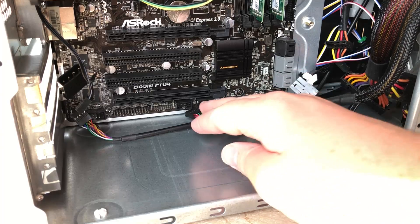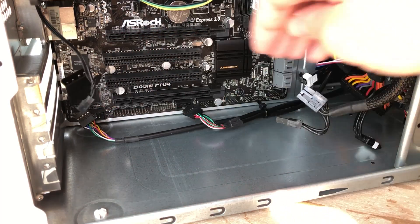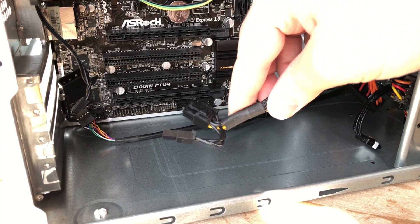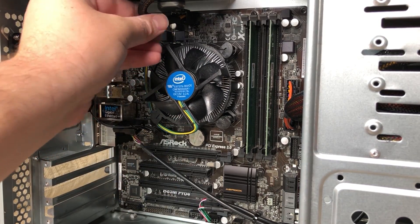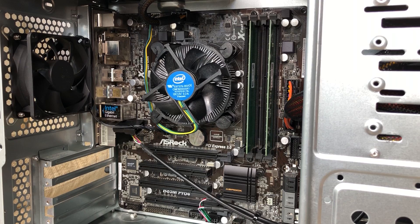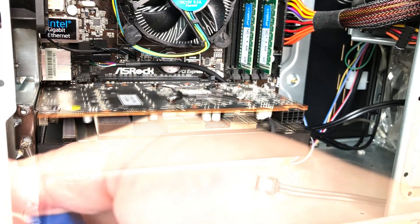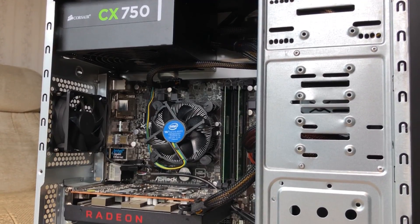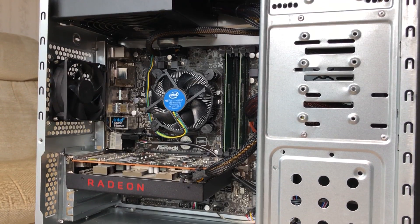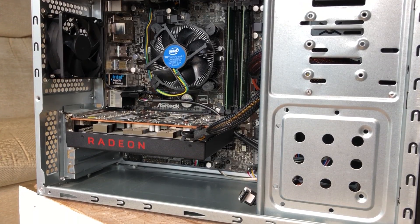Most of this motherboard's connectors are in a similar position to the old one, but the audio header is annoyingly a bit close to the PCIe slot, which means the cable sort of trails across it. It's long enough to be maneuvered around though, so we should be able to put the GPU back in without issues. Just as removing the GPU was the first step, putting it back in is now the last step — apart from turning the machine back on. This case is a little cramped, but for a system with a micro ATX motherboard and a smallish graphics card, there's certainly enough space for suitable airflow. We've got a front and rear 80mm fan in here as well.